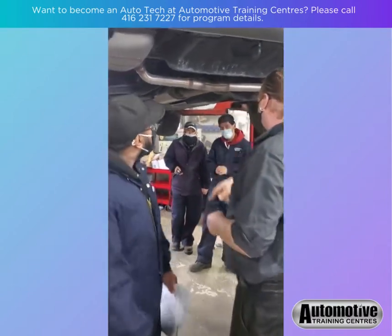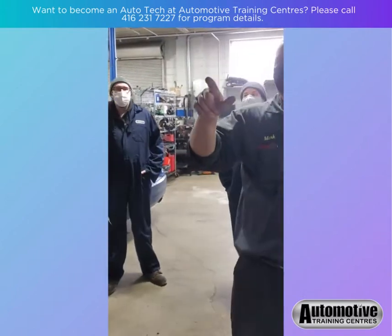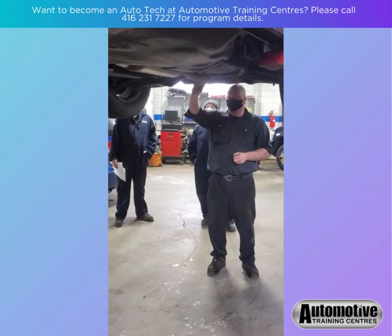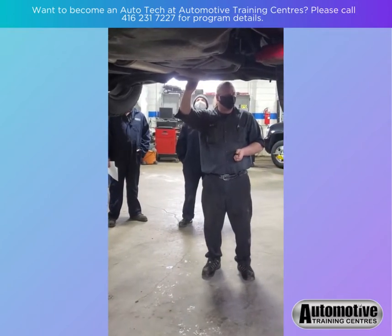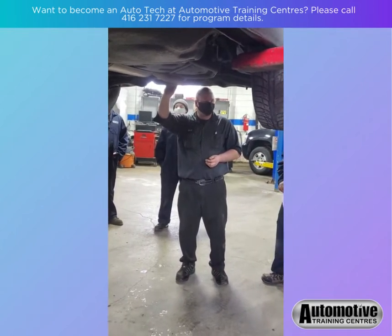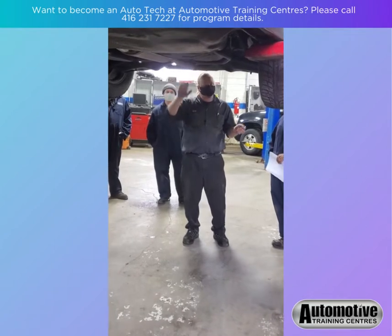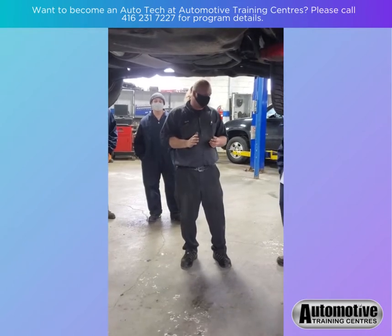So in the case of these vehicles, all those U-joints and stuff like that, they're still in the drive shafts that lead to the rear. However, modern vehicles, a lot of them, you do not replace those U-joints. What the manufacturers have done is they've made a sealed unit, which is no longer serviceable. There are no clips. There's no way of taking that drive shaft apart except smashing it. Now, there are some professional places that will rebuild them, but the manufacturer wants you to replace it. The cost can be astronomical in some instances.